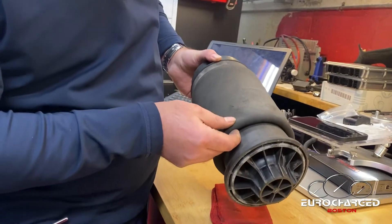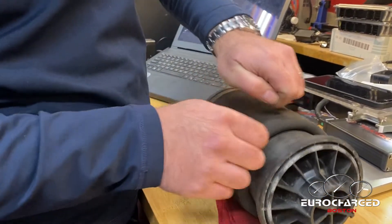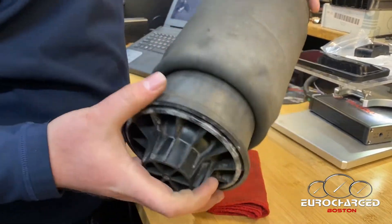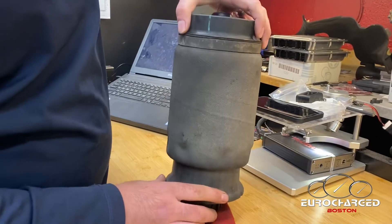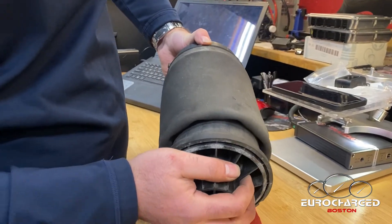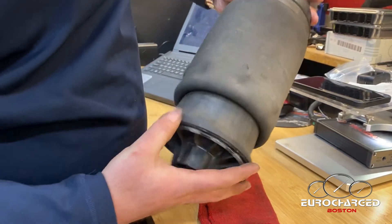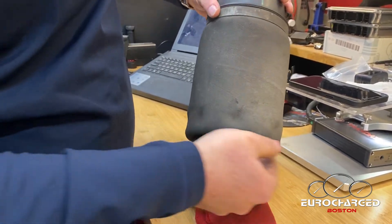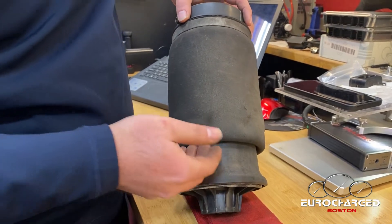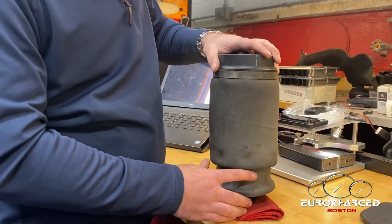As you can see, this design folds the airbag — just imagine how you would wash a piece of clothing and how much wear you put on it when you rub it against itself. That is the exact same thing happening here. If we lowered the car by an inch, the plastic socket goes deeper and deeper into the bag, and it starts to wrinkle — it's no longer keeping a buffer zone between the airbag and the plastic socket. So you increase the wear on the rubber massively, and that's why lowering the car shortens the life of the airbag significantly.